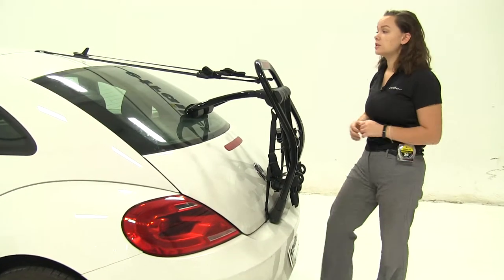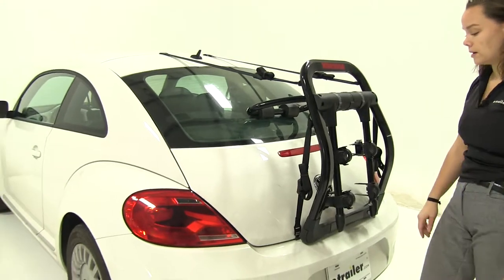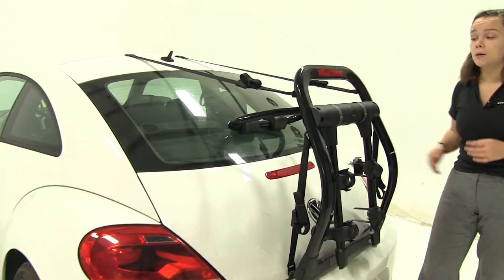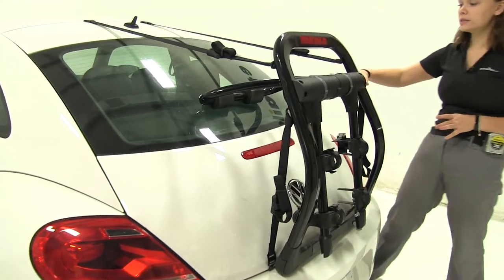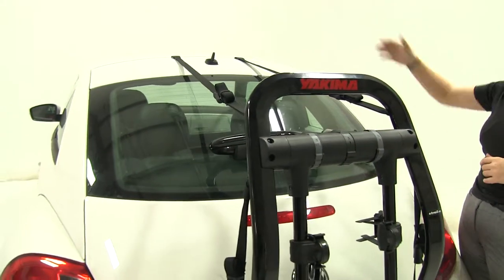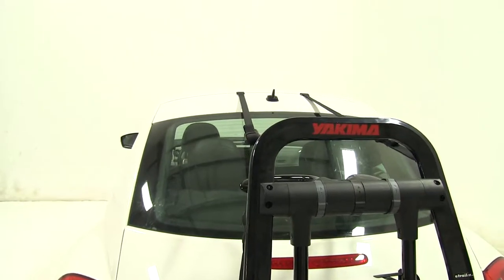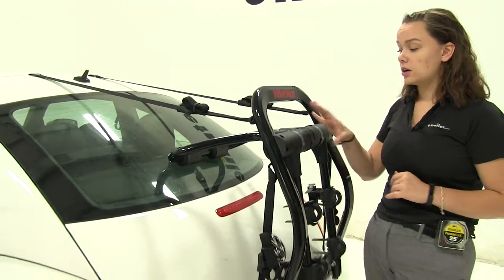As for how our bike is secured down, we have two straps over the top portion of the trunk and two underneath the bottom portion. We also have pads along the bottom and along the top that are going to help prevent scratches or abrasions from our bike rack onto our vehicle. You'll notice this is sitting pretty far down compared to where the opening or the top portion of our trunk is. That is because we need our arms to be either parallel or just above parallel with the ground.